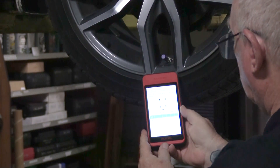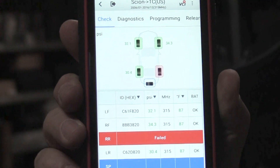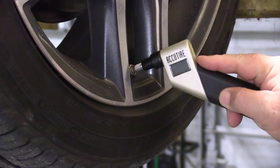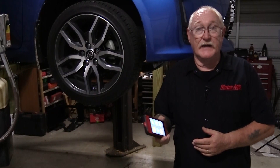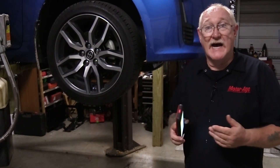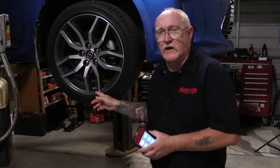The first step is to test the sensors. Look for two things: the condition of the sensor and the accuracy of the sensor. Compare the sensor pressure reading to the actual tire pressure using a digital tire pressure gauge. An old pencil-style gauge was fine back in the day, but it isn't accurate enough for use today. Any sensor that is not fully functional — that is reporting inaccurately, not reporting at all, or indicating a weak battery — should be replaced. And do a visual inspection of the Schrader valve itself.